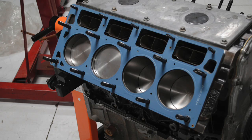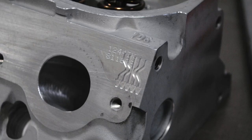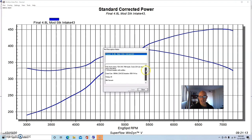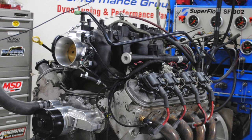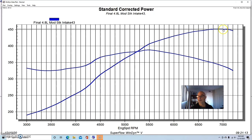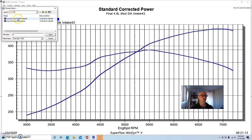Let's start with our 4.8 — a 4.8 LR4 junkyard motor. It had TEA Total Engine Airflow Stage 2 706 heads, a Crane 224/232 cam with 590 lift and 114 LSA — basically a heads, cam, and intake manifold on a stock high-mileage 4.8 short block. We first put the early truck intake manifold that came on the 4.8 from the wrecking yard. With the heads, cam, and truck intake manifold, it produced 452 horsepower and 388 foot-pounds of torque, making peak power at around 6,800 RPM.